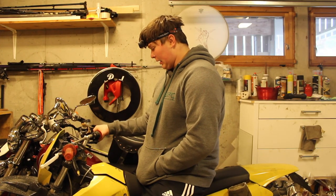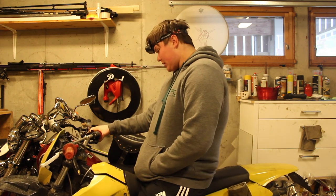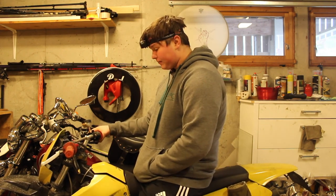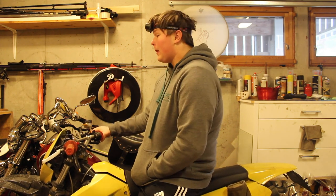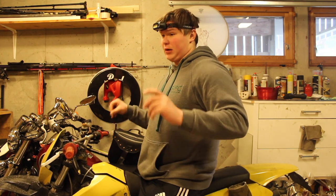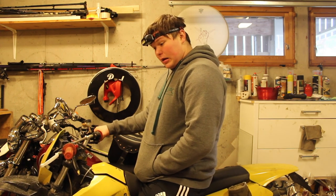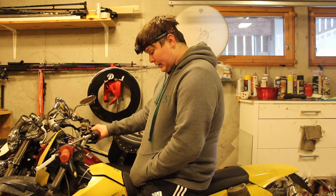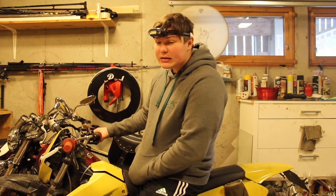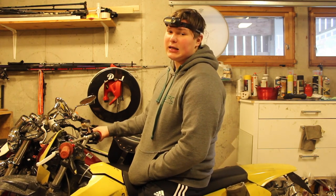The brake is fixed. I am pushing it hard and I see no leaking over there, which is exactly what I wanted. This was a quick tutorial on how to fix a leaky front or rear brake caliper, especially if you are pretty sure it's the O-ring that is feeding oil from one part of the caliper to the second part. I hope you enjoyed this little video — there will be more coming soon. Go ahead and like, subscribe, leave a comment, stuff like that. And as always, keep on riding.